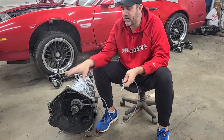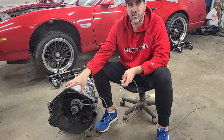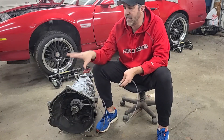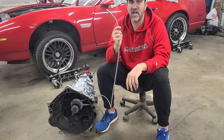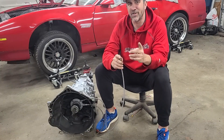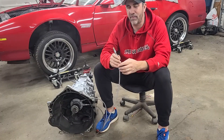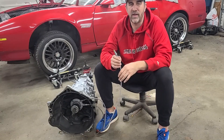It is that easy to install, especially with the transmission out of your car. Now there's a way to install it with the transmission already in, but more than likely if you're bleeding your clutch system, you've already replaced something to introduce air into it, so you need to take it off anyway. I would recommend if you have your transmission out, go ahead and install it. Also be sure to tuck this up out of the way, because it can fall off and drag on the ground like it did in our shop truck — good thing about that is I taught Chase how to drive the shop truck without pushing the clutch in. Make sure you tuck this out of the way so you don't end up having to spend another hundred bucks and take your transmission back out just because you weren't paying attention.